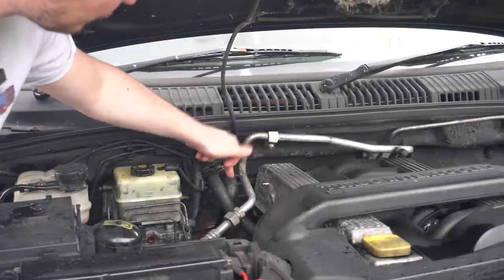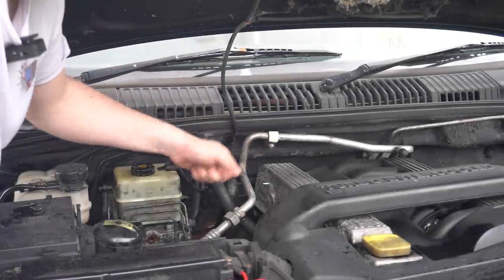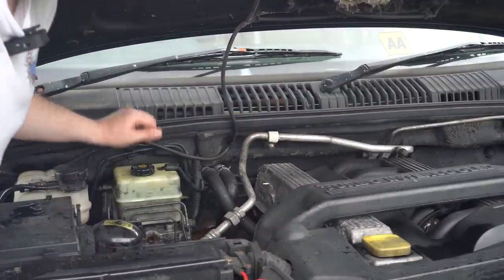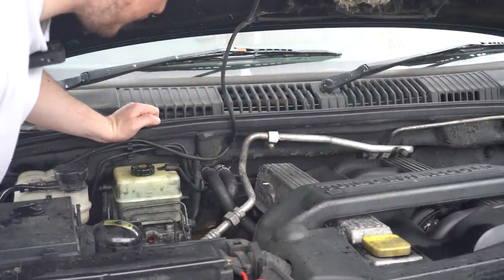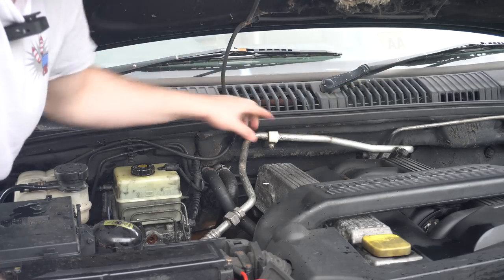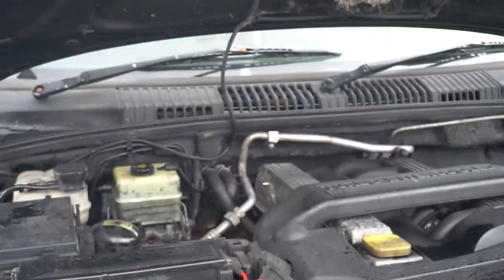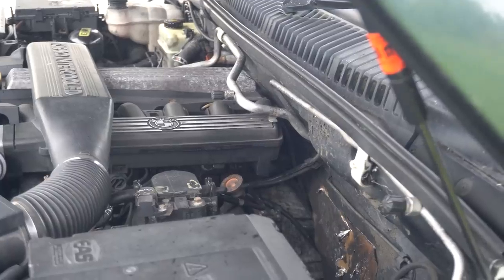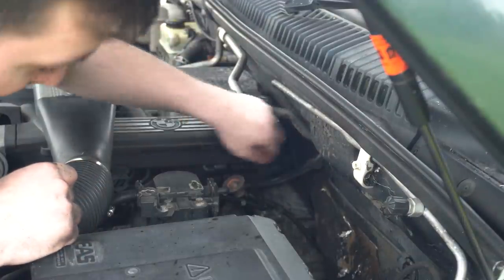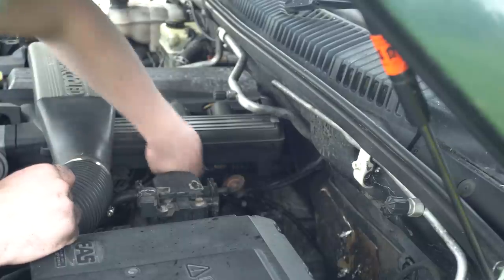So the hose that's leaking is this one that goes into the heater matrix there. So we're going to take off this clip here, pull it off, and hopefully that'll make it a bit easier to get at this one down here. We might end up having to take it off on the cylinder head side over there and then pull the whole lot out. It's probably going to be the best way to do it. So a bit difficult to show you guys, but the pipe comes around the back of the head and then terminates on the cylinder head under here. I can just about feel it.